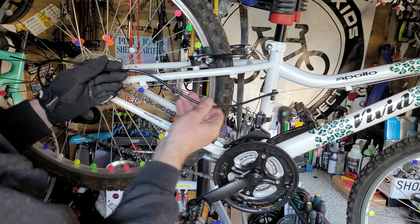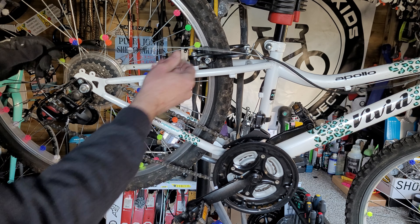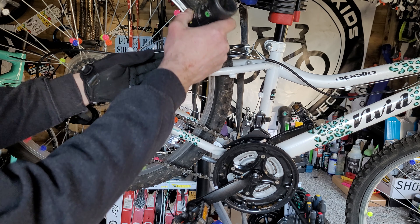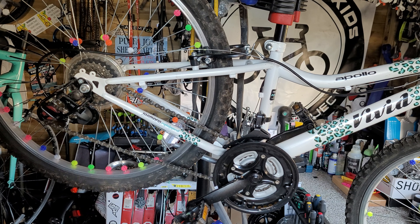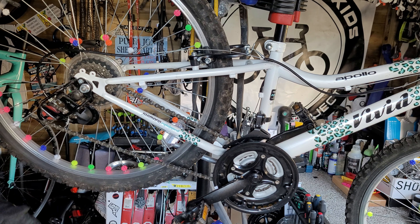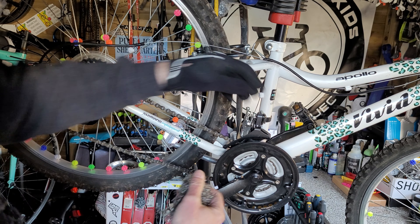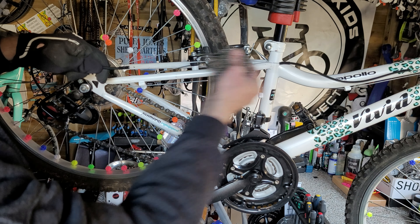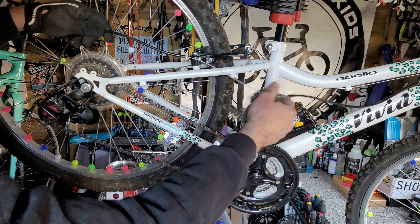So you've got all this cable loose now, moving around. What you can do then is put a few drops of some kind of lubrication onto the cable, and if they're not rusty, just rub it in with your fingers. But if they are rusty, you can use a piece of wire wool and just clean all that surface rust off, and move the housing around. Obviously if the cables are frayed they need replacing, but if they're in good condition with a bit of surface rust and a bit of sticky housing, then this will do the job.